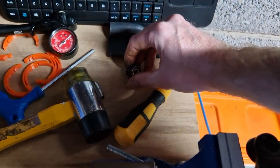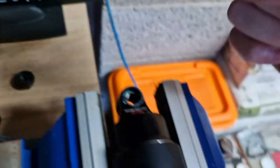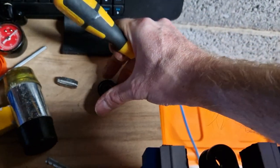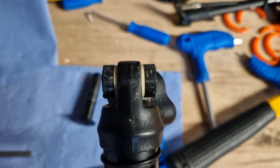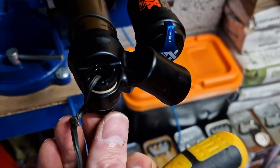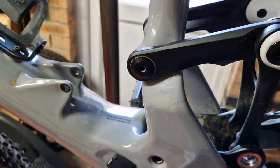This came with cups and bearings on it with the rod through, so I had to work with that. Luckily it sits perfectly into the bearing and onto the top. I put it in a vise with soft grips and tapped it out with a hammer. This bearing race came out with it, and there's one on the other side to tap out too — nothing's ever straightforward. It uses the exact same mounting kit, which is good. It would be nice if it was a straightforward swap but it's not too much of a palaver. I'll get the other bearing side out, give it a clean, grease the bearings a little bit, and then stick it back on.